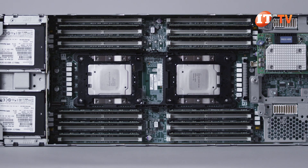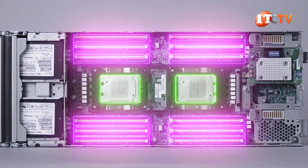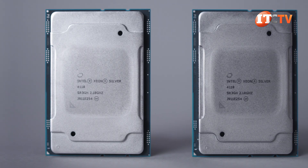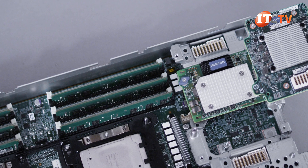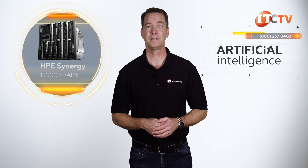There is also an internal USB 3.0 boot port. Just behind the backplane are two Intel Xeon Scalable processors, each supporting six memory channels with two memory slots per channel and 12 memory module slots per processor, for up to three terabytes of memory total with both processors. We have the system outfitted with dual Intel Xeon Scalable 4110 Silver processors from the first generation and only six memory modules per processor for optimal memory performance. The HP Synergy 480 Multi-MXM graphics expansion module is a great option for supporting designers, architects, financial analysts, and other professionals requiring strong graphics support. HP recently announced their Synergy platform is now compatible with HP's Primera storage platform to augment performance with artificial intelligence and machine learning.